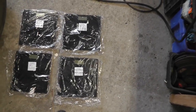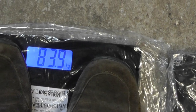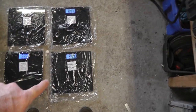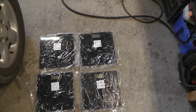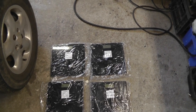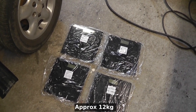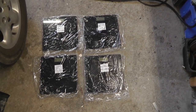So long as they're reasonably close, that's all I'm concerned about. The readings came out as 84.4, 84.1, 83.9, and 83.9 — so the highest was 84.4 and the lowest 83.9, just half a kilogram difference. There are other things to bear in mind: the fuel tank in the car outside is empty, so I've left about 55 kilos worth of batteries on the back seat to replicate a full tank. The car also has a tow bar whose weight I'll try to find out later, so this isn't going to be perfect science but it'll be close enough.